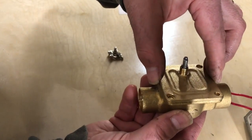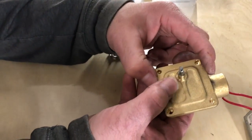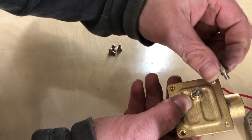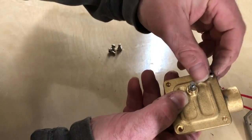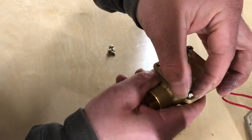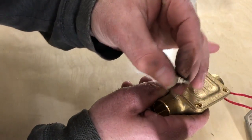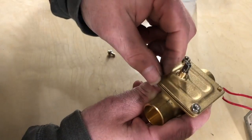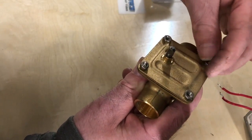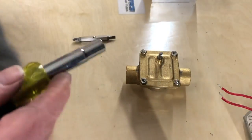Push this together, wiggle it, and it'll fall into place. You'll notice there are two different size screws on the lid, opposite of each other — line up the big screws first. Don't put one screw in and tighten it up; go ahead and start them all by hand. If you tighten it and it's off-center, the little lip here will not allow you to tighten it up. Once all are hand tight, use your wrench or nut driver to finish. Then use the 5/16 on the 11-in-1 screwdriver.